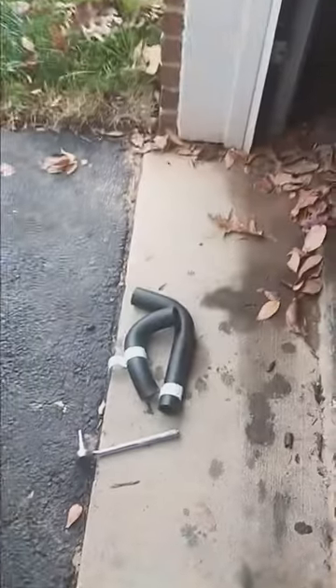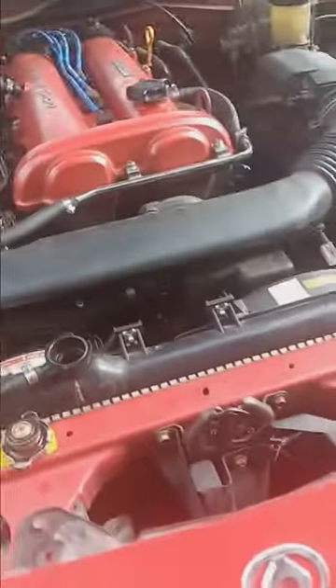Alright guys, so of course I won't be just doing a coolant flush — I will be doing a radiator hose swap as well. In order to get the top one off, I have to get this air intake off, at least enough to get the clamp off of the top one. And then the bottom one — all I have to do is get under here, there'll be one clamp right there and another one up top, and they'll both come right off.